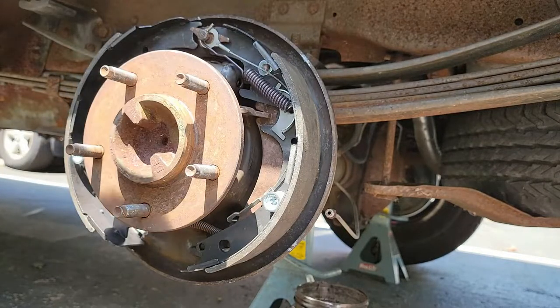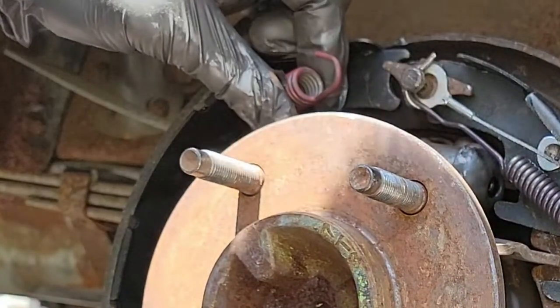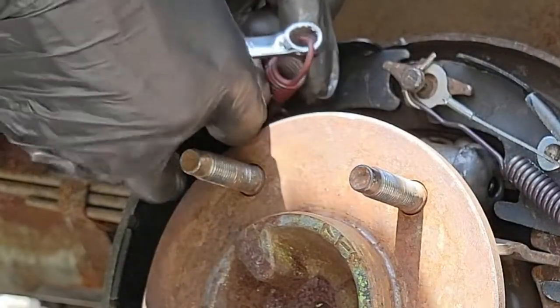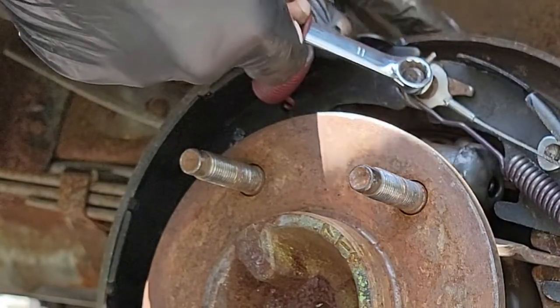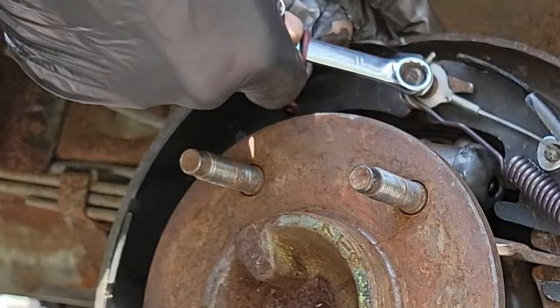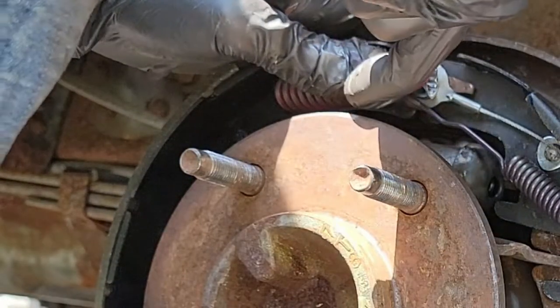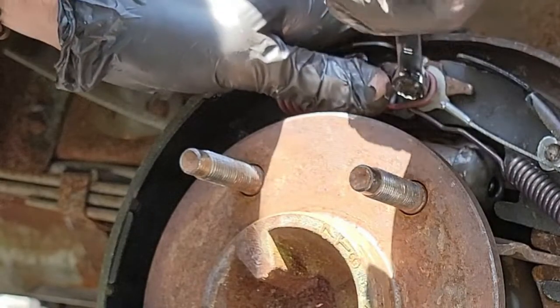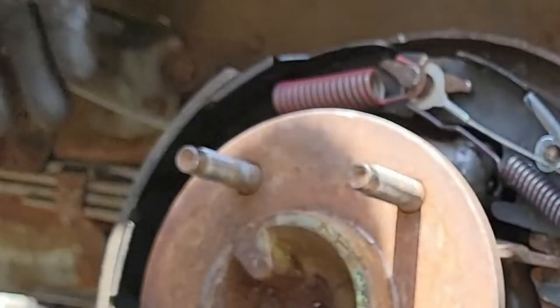Here I will show you exactly how a wrench can be used to get that spring in place. With the circular end of the wrench facing up like this, place the spring around the shaft of the wrench. Then put the open end of the wrench around the anchor pin and drive the spring over the wrench by moving the wrench to the right. You may also have to twist the wrench to release it from the spring's grip. The spring should fall right into place. This is a lot easier to use than some of the special tools made specifically for drum brakes.